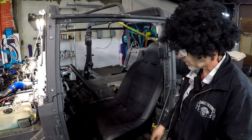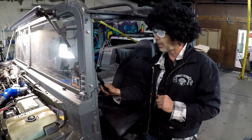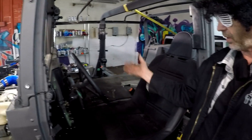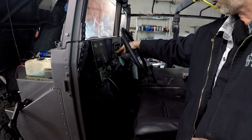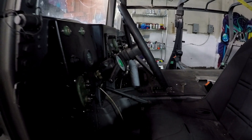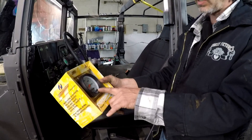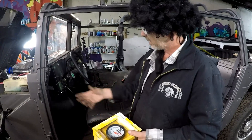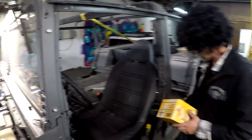Those are pretty much the majority of your wiring tasks. There is a little bit of interface as far as power and ground back to the factory dash. This one is actually getting the upgraded dash version. We've added the upgraded dash to the center section — it's going to be really cool. We're changing out all the gauges currently on the original IPC. Instead of the stock-style gauges, you'll have Autometer gauges, which are very accurate. They allow you to calibrate tire size anytime you want — you can change it right at the gauge without needing a download or upload into the computer.